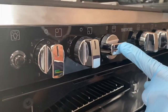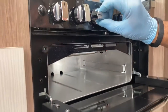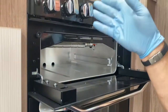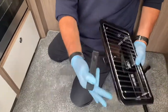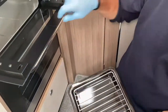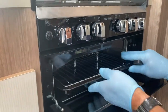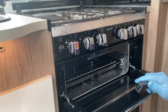For the grill: turn to full flame, press and hold the valve, press the igniter — the flame is visible under the grill pan. Low setting is down, high is up, off to close. The grill pan handle attaches on the long edge at a 45-degree angle for easy removal. Inside the grill there are two runner positions — lower for things like bacon, higher for toast.